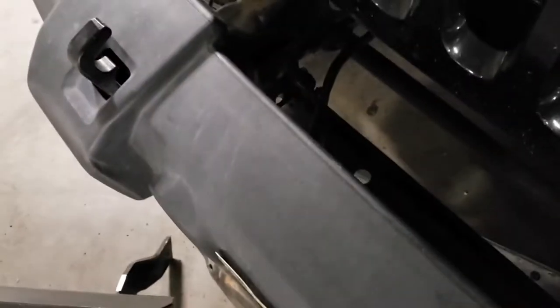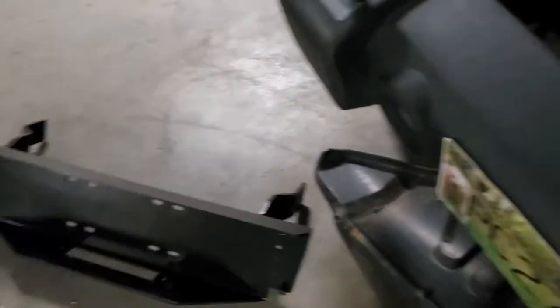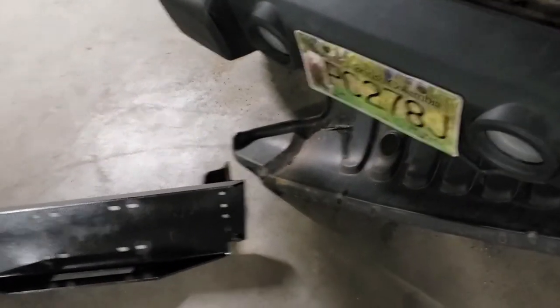So I'm about 15 minutes into this. I removed the plastic cover that covers the frame rails, unhooked the fog lights — don't forget to do that. They say you don't have to remove the bumper completely, but I tried to slide it in there without removing it and figured I'm going to take it right off so I can make sure I'm getting everything lined up.